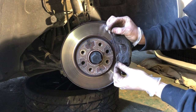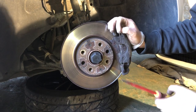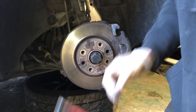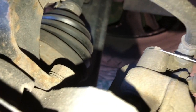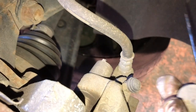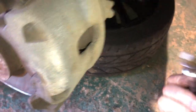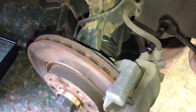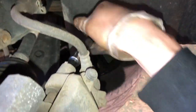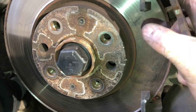First, take this retaining pin out — I just use a screwdriver to force the spring off the caliper. There are plastic little covers over the bolt holes you just pick out to keep dust out. Then you want the H7 bit, which fits nice and snug in there. Crack the bolts off top and bottom, then with a bit of persuasion the caliper bracket comes off.